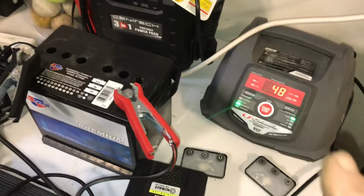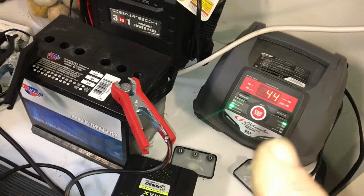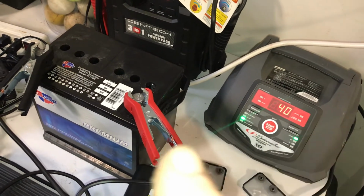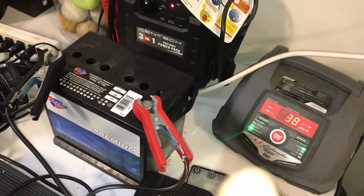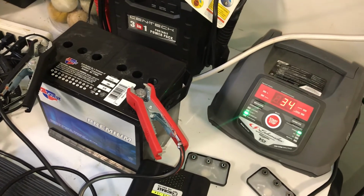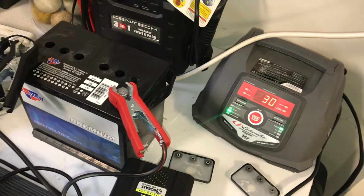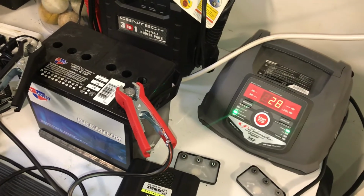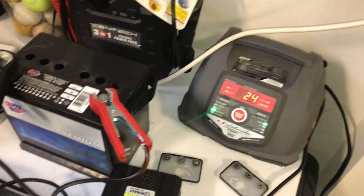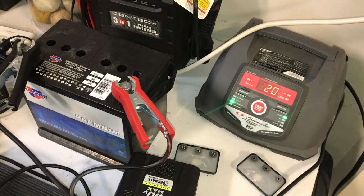This is my second cycle of 15 minutes with the 100 amp engine start, and as soon as this 42 seconds is over, I'll show you. But what's amazing is that this battery was only showing 10 volts when I started. Even after charging it and showing that I was 100% charged with this battery charger, when I disconnected the charger, it immediately dropped to 10 volts. So in just a few seconds, I'll show you what's happening with the battery performance. It's absolutely amazing to me.